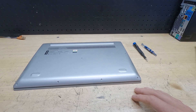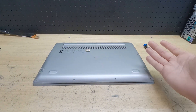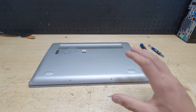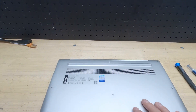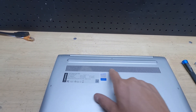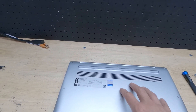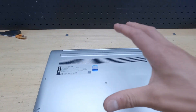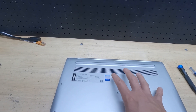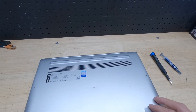The next thing I assess is: when it's overheating, what is it doing? Is it just getting hot and shutting down, or just running real slow? That determines how far we need to go. Sometimes it's as quick as taking a can of air duster and blowing out all the dust from the fins because they just get trapped with dust like any computer. Other times we have to go more invasive - depending on how bad it is - and change the thermal paste. Laptops cram a lot of hardware in there so there's not much room for fresh airflow.